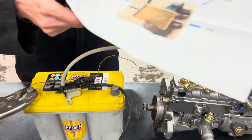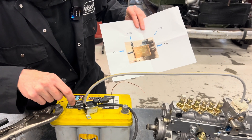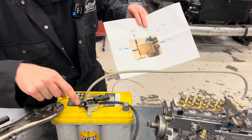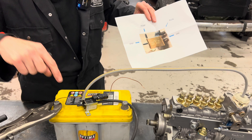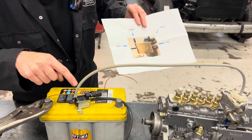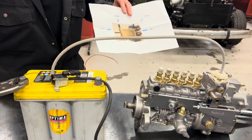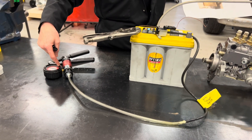The pipework is explained on the diagram. This front port here is the vent, so that needs to go to a little filter, or just put a pipe and a U-piece — just don't let anything get stuck in the end of it. This one says pump, and that means injector pump. The back pipe is vacuum to the actual vacuum source in the car.